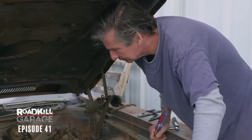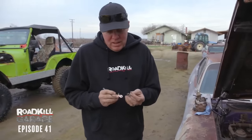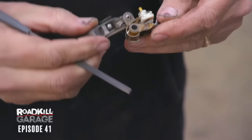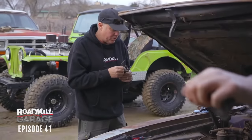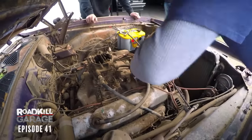These points are wasted — no way. Steve's old points were literally melted. This is supposed to be a contact block to rub on the cam, but it's melted. And that's supposed to be an isolator — it's not isolating, it's junk. Now I've got the points theoretically functional, although the distributor is just rotating freely in the block. The timing's going to be way off, but we'll still be able to see if we have spark.